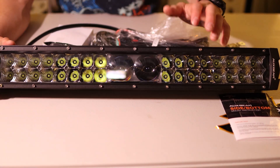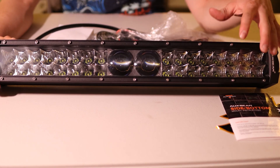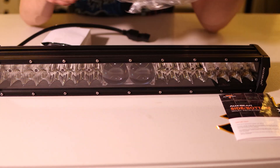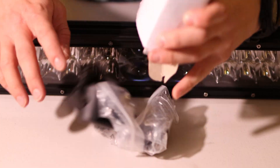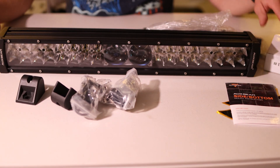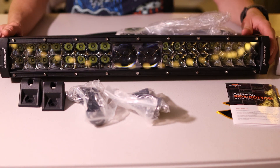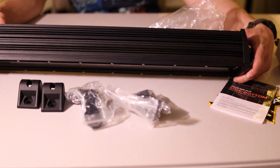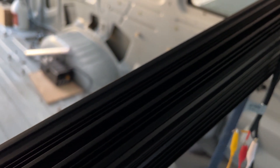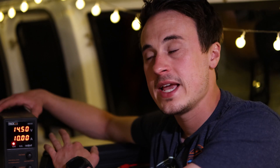From what I've heard those Osram LED drivers are really good, which is probably why it's more expensive. The color temperature is 6500K — a little cooler than the Side Shooter. It claims 22,000 lumens and a distance of 1 lux at 509 meters. This one comes with the wiring harness — which I'd hope at that price — plus instruction sticker. Unlike the others, it comes with both bottom mounts and side mounts so you can choose. It also claims IP68 and has a high-efficiency cooling system with some big massive heat sinks.